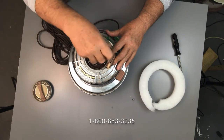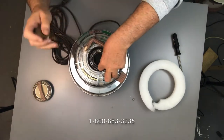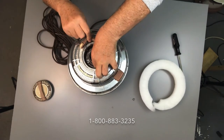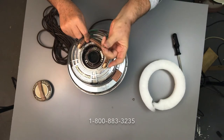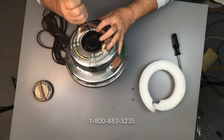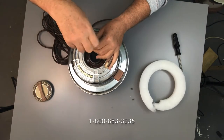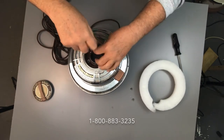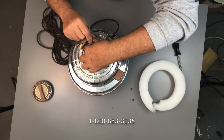When you put it back together you don't want to make it too tight because it will strip the screws. You can see they're just a really short self-tapping screw — you don't want to over-tighten them. Make them tight, not real tight, more than snug but that's all you need. It does hold the top on so you can lift the whole machine up with the handle.